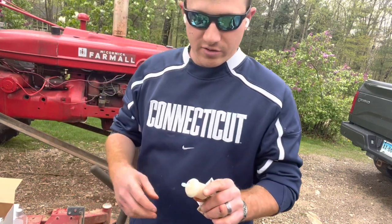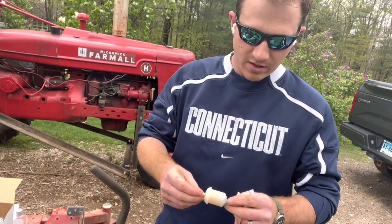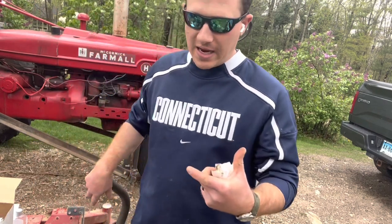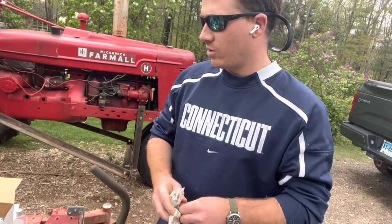The kit also comes with an air filter and a fuel filter. Mine is pretty gnarly — a lot of dust — and that'll eventually work its way into the fuel system. You can definitely tell the difference when you need to change one of those. You start hearing engine lag a little bit when you go forward with the joysticks — a little bit of hesitation. Something to keep in mind if your mower isn't as responsive.